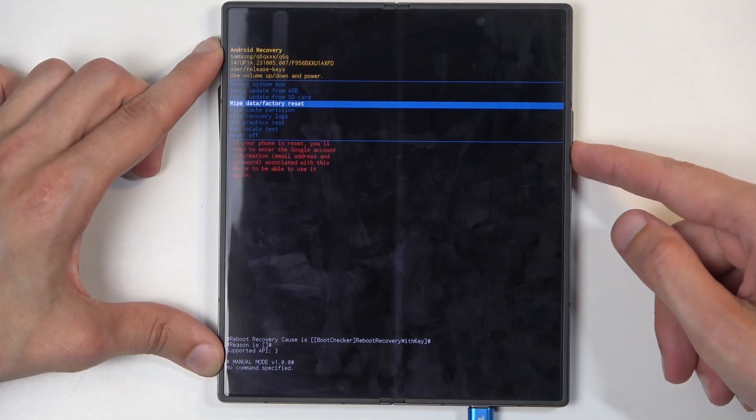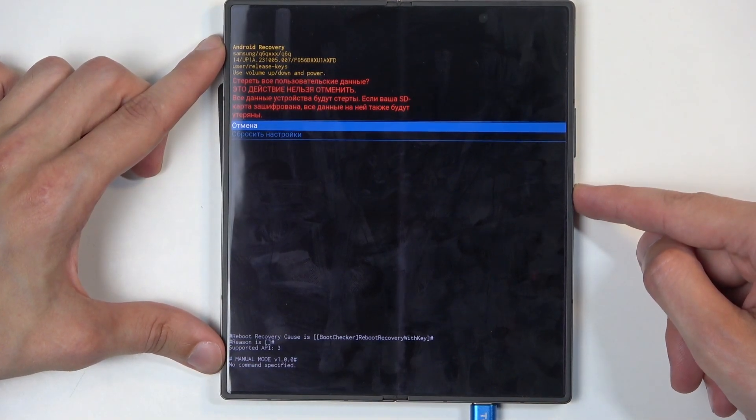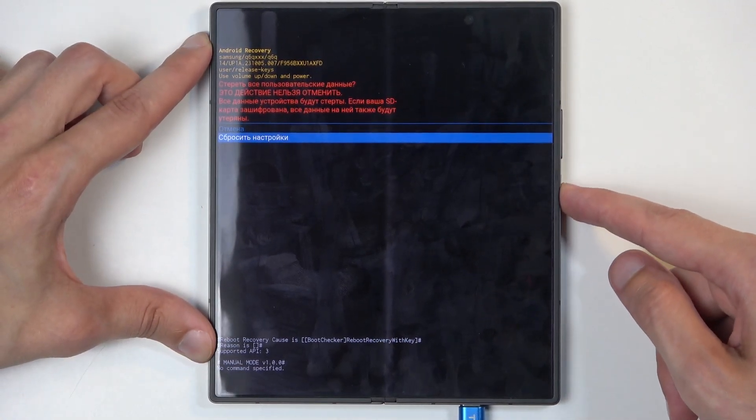For people that turned off their device normally — when you select power off you will see the Samsung logo. Once that logo disappears, hold the power button and volume up the same way. Once you see Samsung then Galaxy, you can let go of the power button and then volume up once you see recovery mode. In here, using the volume buttons, scroll down and select wipe data, factory reset, and confirm it using your power button. Then select the second option — which for me is in Russian or Ukrainian — but in any case, the second option is the confirmation, so select that and confirm it.